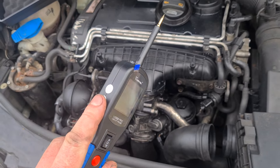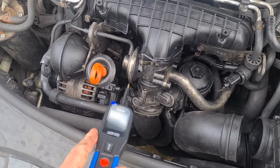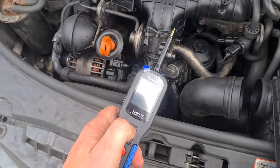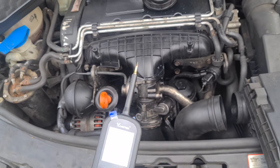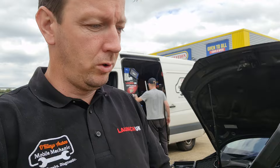One of the many uses for this that I've often used in the past — if you want to test if you've got a power supply to your starter motor, for instance, and if you want to verify that a starter motor is working, you can put this to the starter motor and put your 12V supply to it, which will make the engine turn over. That will confirm if you've got a starter motor working. In the wrong hands it can be quite dangerous, so I'm pretty sure anyone who's going to buy one will know what they're using it for.